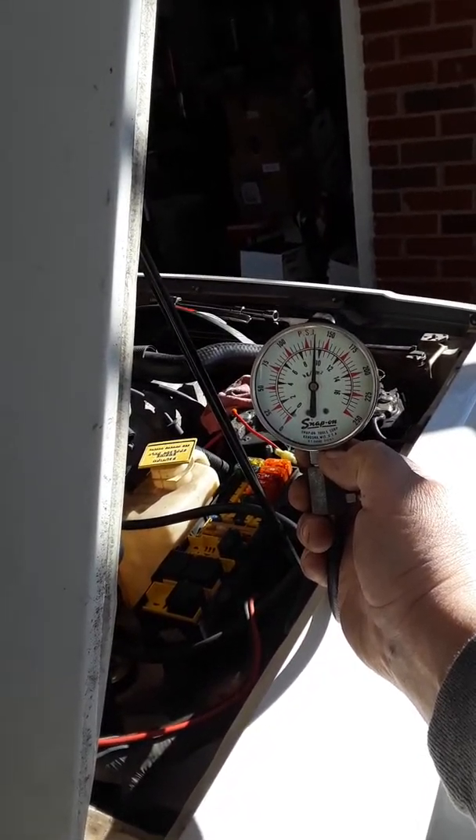Start it again. Stop. Yeah, that is definitely way beyond low. That is way low. Those compression rings are gone. Okay, and it is holding at 80... yeah, 85 psi. And it is holding at 90 psi. Okay. Stop.